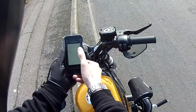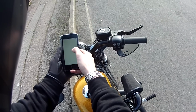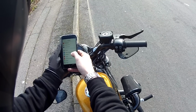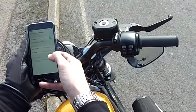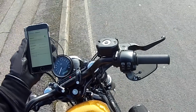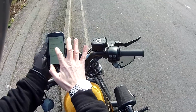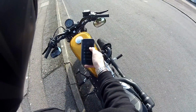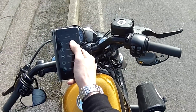What I need to do now is go to settings. I'm hoping you guys can actually see this. Go to settings on your iPhone or other Android device, to Bluetooth. Then what you'll see is a VIN number. That is specific to your Fuel Pak, so if you click on that, now I'm connected. I've got these different options here, so I'm going to go to auto-tune.